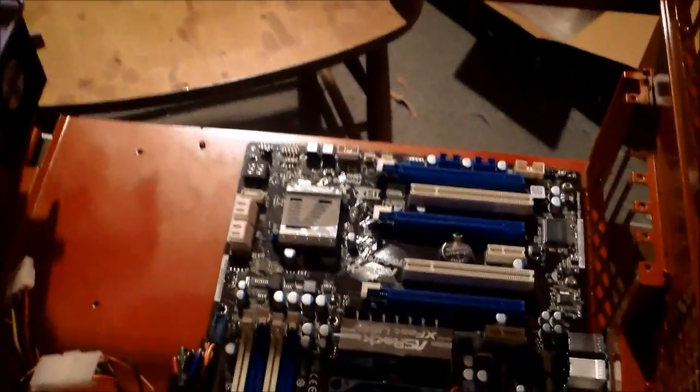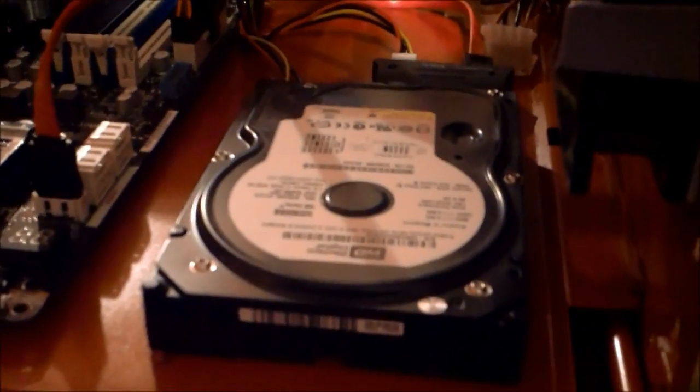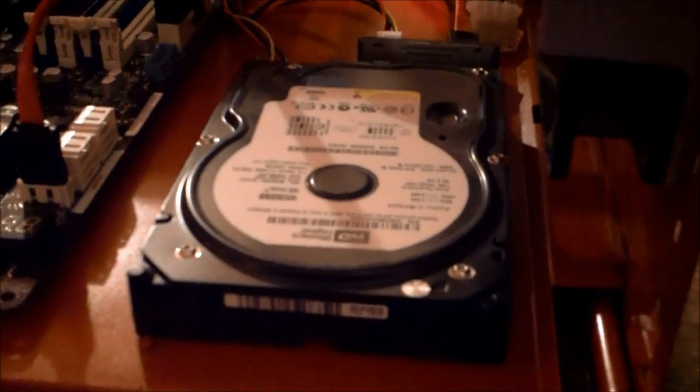That's plugged in. And then it actually comes with a couple of Molexes, and I run the fans off of those. So we're good on that. A lot of extra wires, which I'll run to the GPUs for power. So now I'm just going to put the RAM in. I'll put it in the first slot, all the way closest to the CPU. The hard drive is now installed with its crazy adapter, so we're going to put a video card in.